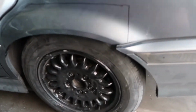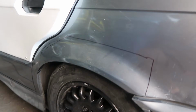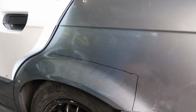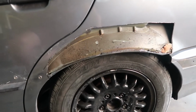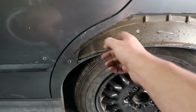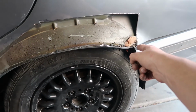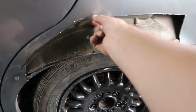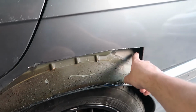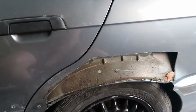All right, so the rear is 2 pieces, so it's going to be a little bit harder, and I don't have a welder on me right now to weld it up and seal it. There is seam sealer, but I'm going to fold them up, basically weld them to themselves. So at this point right here, I'm basically going to cut everything where the skinny part is meeting up to the door. I'm going to cut a straight line down here, all that'll be gone, and then I'm going to relief cut all of this all the way over, and then fold it up, cut the excess off, probably leave about a 1/2 inch to a 1/4 inch, so that we can weld it on. We'll shoot some sealant back in here because this goes to the trunk, but other than that, nothing will get this way, and we should be good.